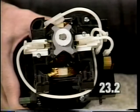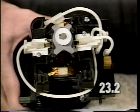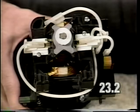If the motor is wired backwards, it will cause the brush roll belt to slip off of the end of the fan pulley and get caught on the belt lifter hook. Refer to step 10 for proper brush lead wire routing.